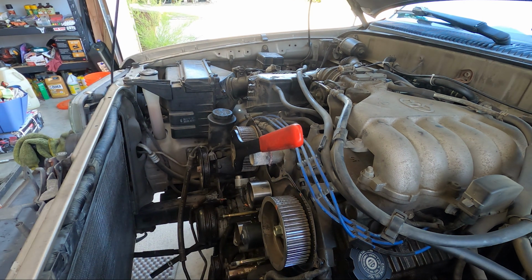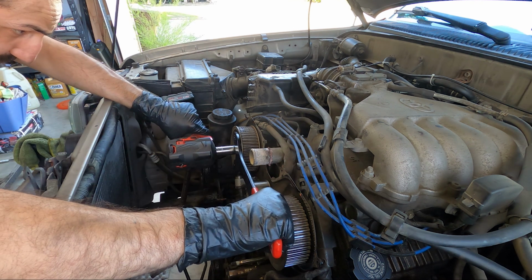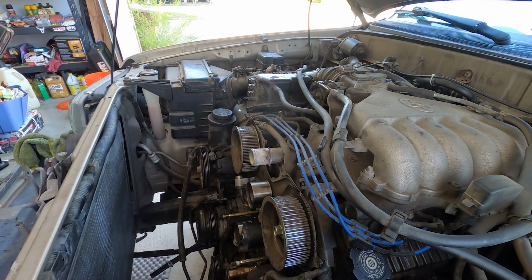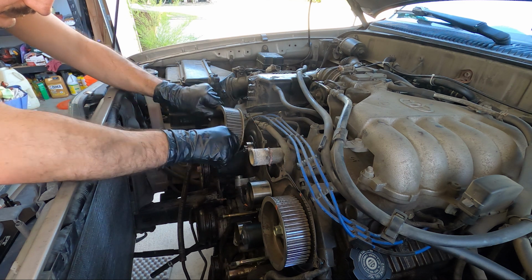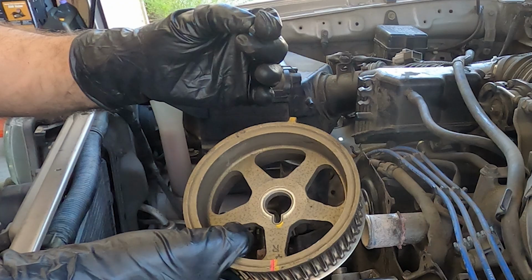Okay, now you're going to want to use this cam pulley tool like I have here. I'll link it in the description below. That's going to link up on the cam to hold it in place while we remove the center bolt, which is normally torqued to about 81 foot-pounds. There's also a little dowel that holds the cam in place, so take a look at it here on the screen because I didn't video it.